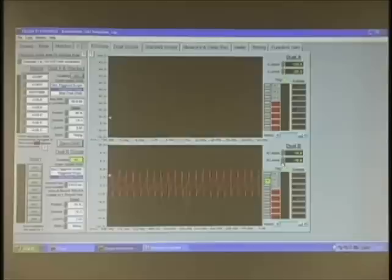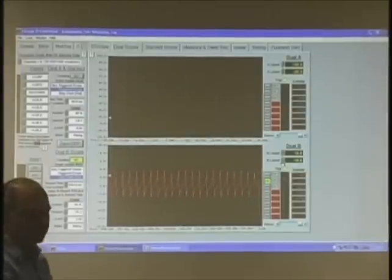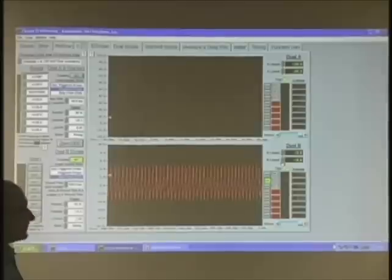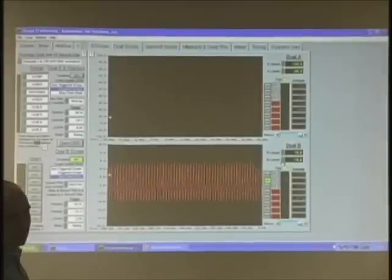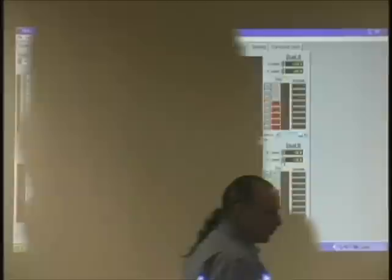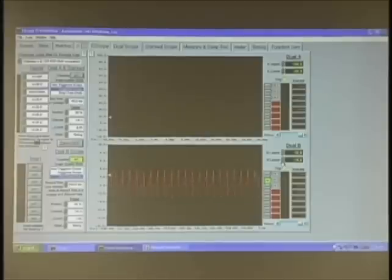As soon as we went to lab scope, he got a signal. Not on graphing meter, you're not going to get the signal. Start out on the lab scope. So, this signal, we rev it up. What happens? Frequency changes. You could use this for wheel speed sensors. You could use this for crank sensors, correct? You see your frequency change. Does everyone understand that? So we just spent a lot of time helping you set this up.